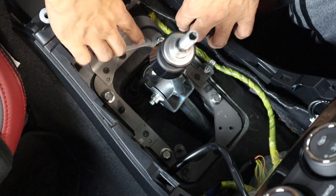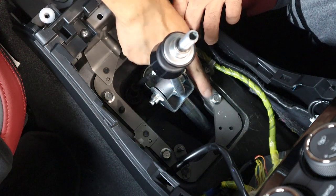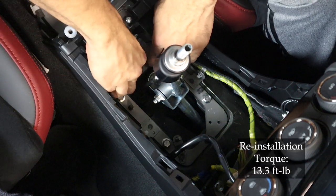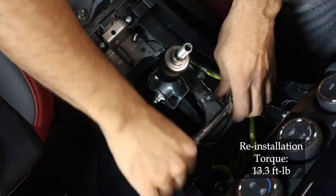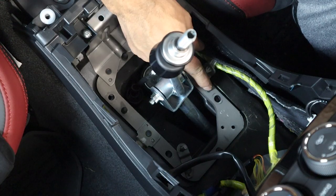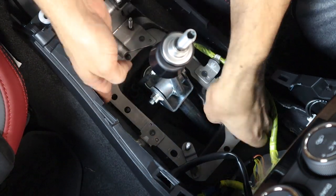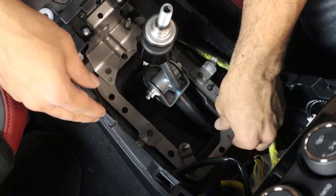This frame right here is securing the lower boot in place, so we have to remove the four 12 millimeter bolts around the frame and then with a Phillips screwdriver also loosen the two screws up here. You don't have to remove them all the way — just loosen them enough so that you can easily move the frame underneath. That lower boot is very important as it keeps the elements outside of the car. It also attaches to the frame in four spots, so you have to lift up the frame a little bit and then slide the rubber boot out from those holes. Once you do that, you can leave it in place and then we'll be ready for the fun underneath the car.